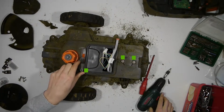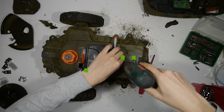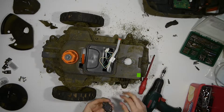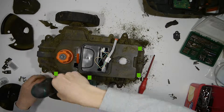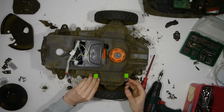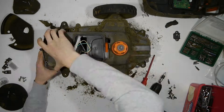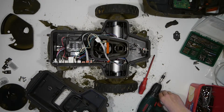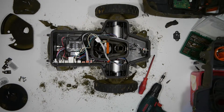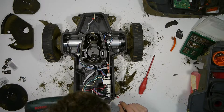Now we can remove the two silver screws and one in the middle where there is this orange plastic part that shows the height of the grass cutting. Again remove every visible screw on the outside, then remove the orange covering of the circle in the middle, and then remove the top plastic which covers the main electrical segment of the device.